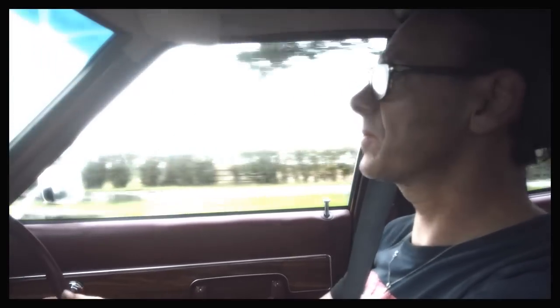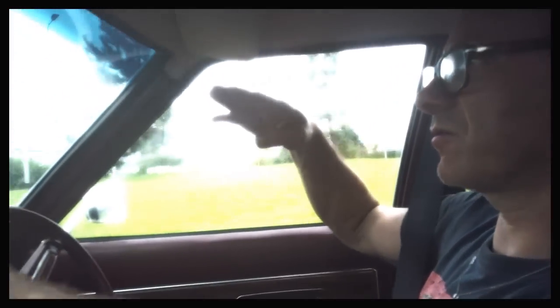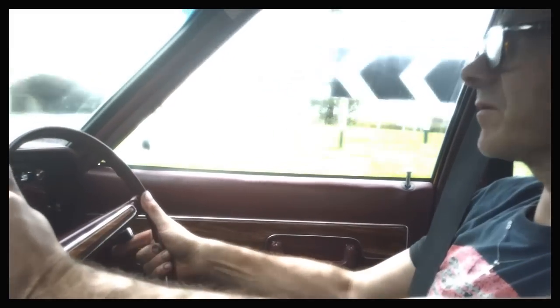It's quieter than Ruby's axle certainly on overrun. It could be a bit of prop shaft UJ alignment there on acceleration. I noticed it wows on acceleration as the nose is brought up. We are two up though when Richard gets out. That's what happened on the other car. You obviously get a little bit of difference, although the actual suspension is designed to try and keep the nose level. The way the arms work, if you look, it tries to always keep the nose the best that it can level in terms of the angle to the prop.